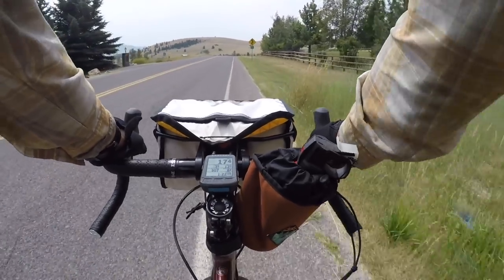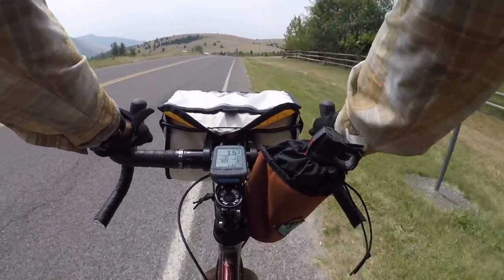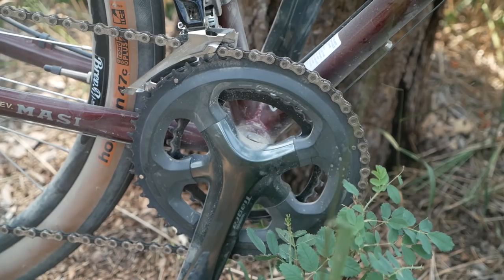In terms of what I liked about the bike: it rode really well on the road, had fairly neutral handling, and handled a front load well even when climbing. In terms of cons, one off the bat is that although it has the low trail front-bias geometry that rando bikes have, it does not have the rando bike gearing. I'm not a fan of the compact road double, in particular on any bikes that are meant to carry stuff — it's just too highly geared. I know there aren't any kind of readily available wide range doubles, but I think that would have been a more appropriate gearing choice for this.